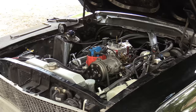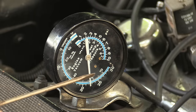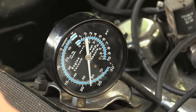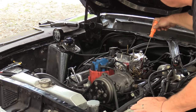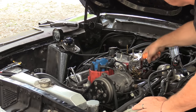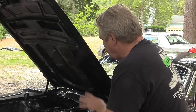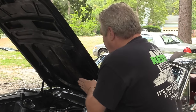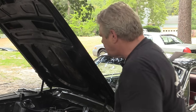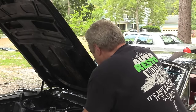With the back metering plate screws, you do the same thing — one and a half turns as your base point. You'll also want to be doing this when the engine is hot. I did one turn on that one because the idle was dropping down and wasn't happy. We're now reading about 22 and a half inches of vacuum, and the needle has pretty much stabilized — that tells me we're in a good spot. I'm going to back the idle itself off a little bit. You want to be idling around 600 to 700 RPM on one of these carburetors.